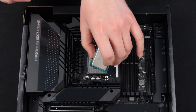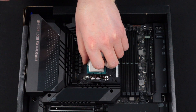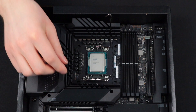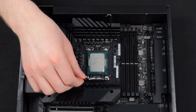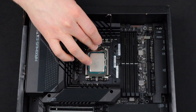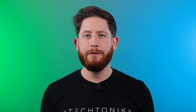When you install an Intel CPU into the LGA1700 socket, you use the independent loading mechanism to lock the CPU into place. This mechanism puts uneven pressure onto the integrated heat spreader, which may result in bending or warping. That bending and warping causes heat sinks and water blocks to have little to no contact on portions of the IHS, resulting in poor heat exchange and overheating CPUs.